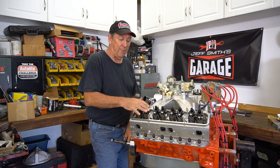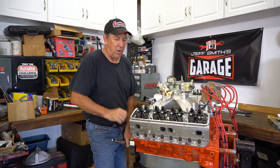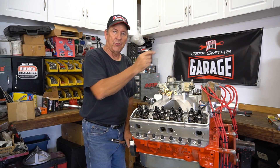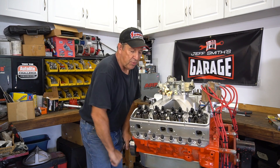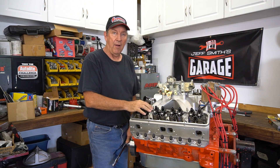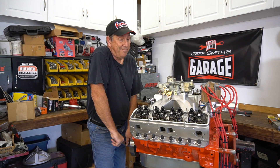Now we've set the first pair of valves — we only have seven more pairs to go. What I like to do is run through these in sequence. You will end up turning the engine over a couple more times than you would if you tried to keep track of firing order, but you'd just get confused. So we're turning the engine over — we're already at intake closing, so we would just continue to turn until exhaust opens, and now we're ready to set the next pair. Run through each pair of valves for each cylinder, come around to the other side, do the other side, and you're ready to go. All you have to remember is exhaust opening, intake closing, and you're there.